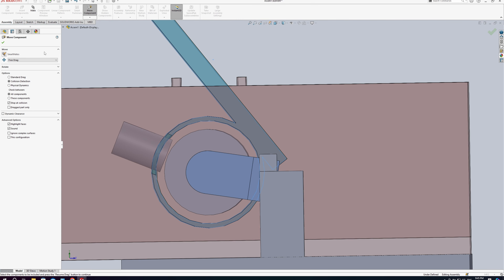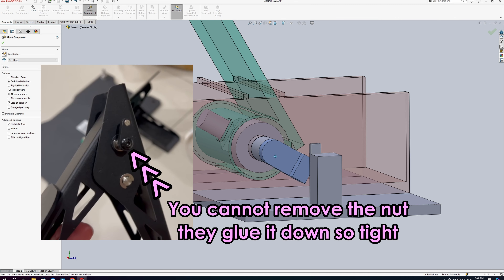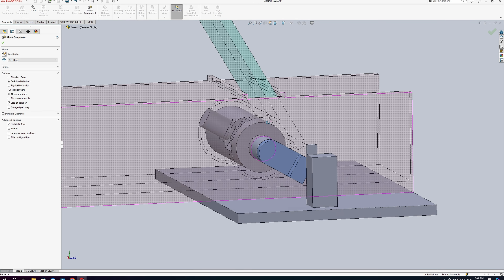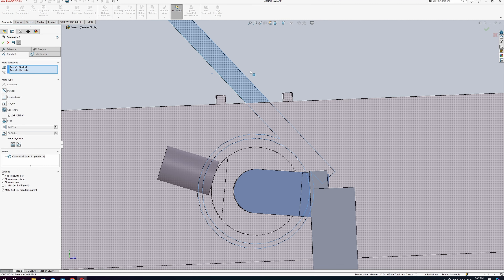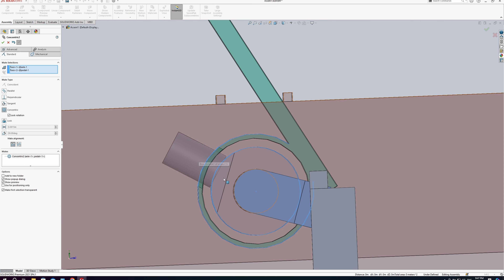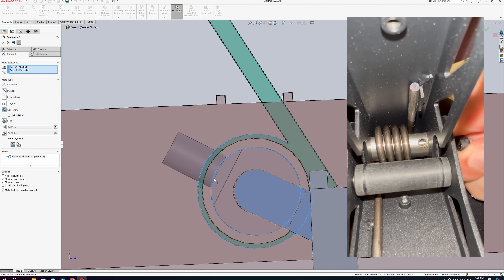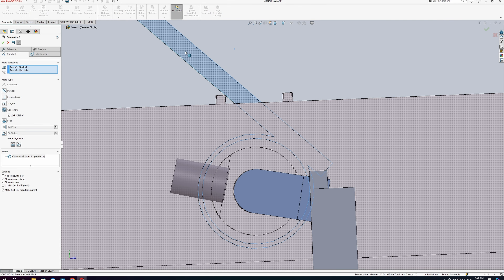The main problem is that this fix is not easy. Cammus has glued the magnet and the axle together. You have a nut here, but you cannot remove it — so you cannot move only the magnet. If you move the magnet, the axle moves too, and when the axle moves this screw won't be in place. What I need to do is adjust so that when you press all the way the magnet is in the correct position. But the nut used to secure everything doesn't work here because the surface isn't flat, and screwing it in pushes the whole axle and magnet back to the original position.